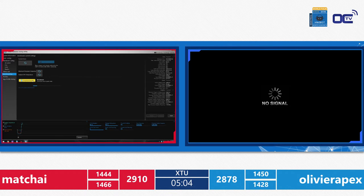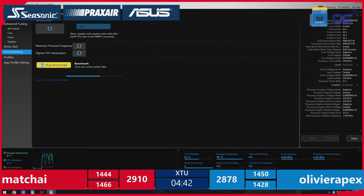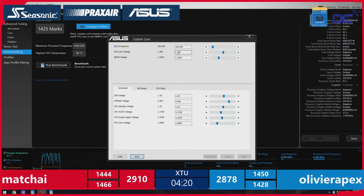So indeed, maybe some questions from the Twitch channel. I think maybe the first one, is it possible to overclock an i7-930? Of course it is. You can overclock almost anything. The thing you have to take into consideration is that your current CPU speed is made up of two factors, which are the CPU multiplier and what we call the base clock. Your CPU is maybe 28 multiplied by 100. And on that platform, you can even go as high as 200 B-clock. But you have to read up. There are good sites like overclock.net, which have a lot of very useful information. If you just Google how to overclock your i7-930, you will find a lot of information on how to do it slowly and steadily.